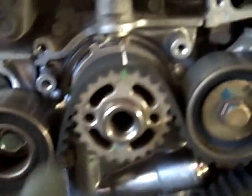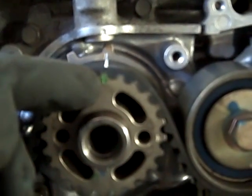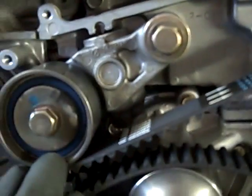This is the best way I've found to put the timing belt on a Subaru. I'll crank this one so that it's slightly clockwise so that the lines don't line up exactly. That allows me to get this one. You can see the little timing mark back up in there on the tooth and then also a green one on the face. I go with this one. Once I have that one on, then I do this one last — it'll be a little bit to the right once the slack's taken out of the belt, on account of this is where the tensioner is.